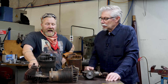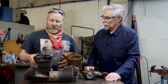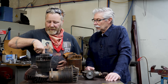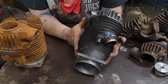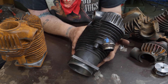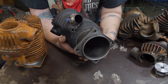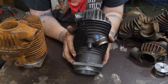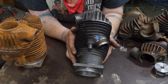The Ricardo cylinder has a 74-style larger intake port and a larger exhaust port. It traditionally ran the larger, later 1924-and-up larger diameter exhaust valve. This particular set of Ricardo tapered fins were our first test set, and they've done over a thousand hard miles. And as you can see, the bore is still beautiful — testament to the quality of the material from Beckwith Iron and Steel and testament to the machining.